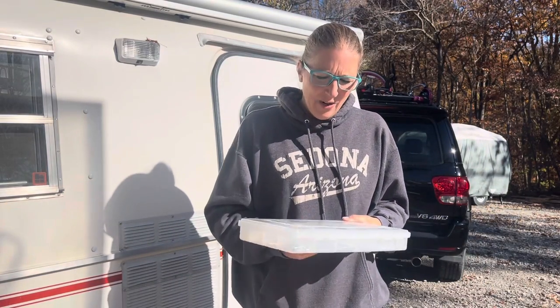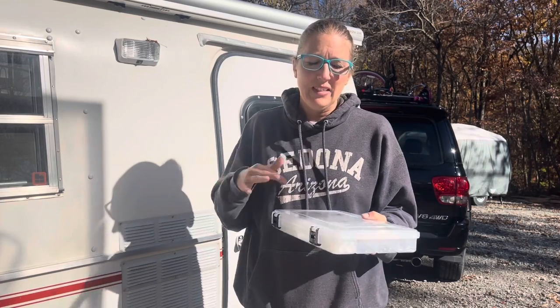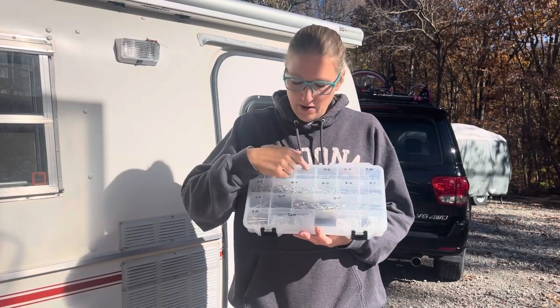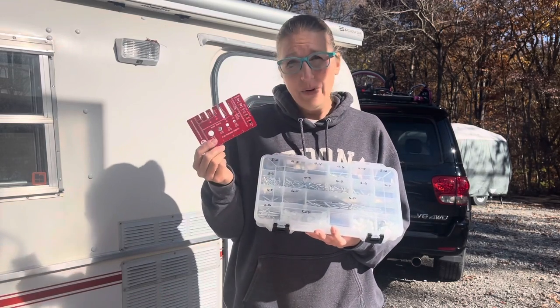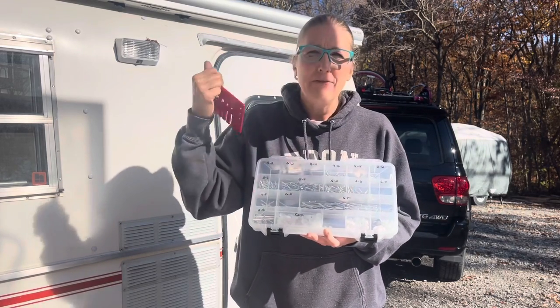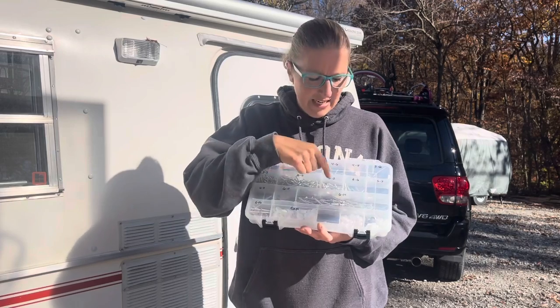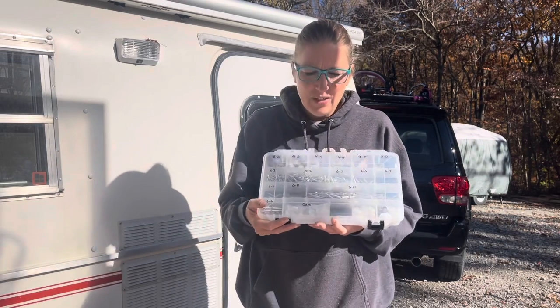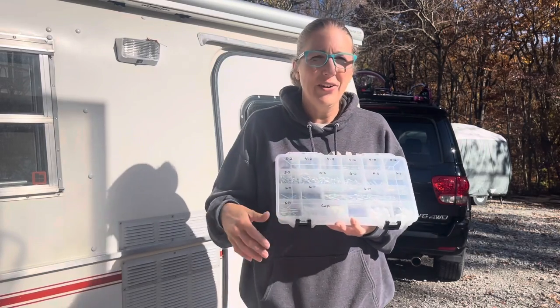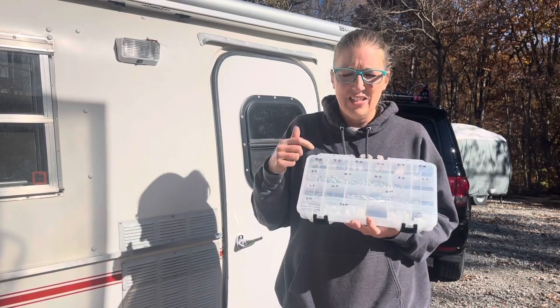I got the multi-pack but since I was replacing so many rivets I had to buy additional ones. To make my life easier I got a fishing organizer and put all my rivets in it. I used the measuring tool to figure out what rivets I had and put them in the compartments, labeled using the Scamp-style label like five-five or whatever. This makes it really easy — once I know I have a 5/32-inch wide rivet, I can pull out the number fives and test which one fits.